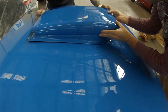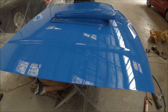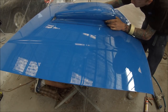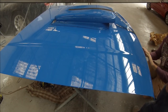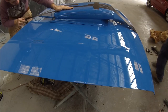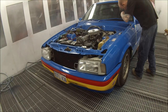This is where it helps having a couple of people — make sure you line it up. You don't want to get it in the wrong spot and then you're moving it around and you get your urethane oozing too much out the edges. My mate's down underneath there with his cordless drill putting the screws in. When you're putting those screws in, don't over-tighten them — you can actually end up pinching the bonnet. The skin of the bonnet will start warping if they're too tight, so you just need them just tight enough so they're biting.